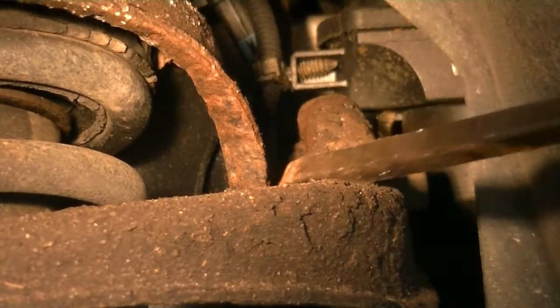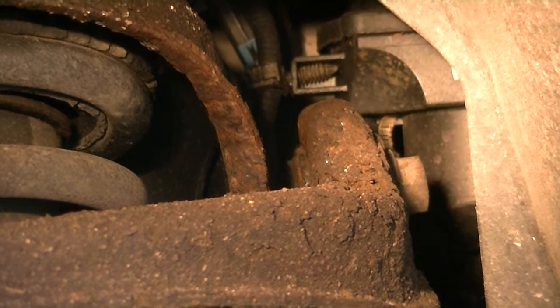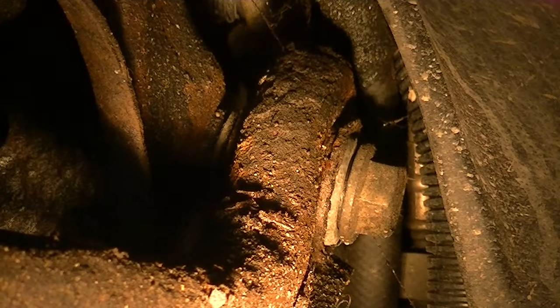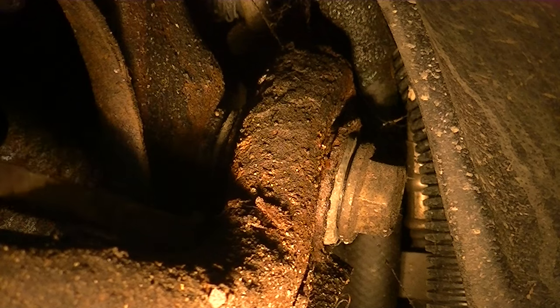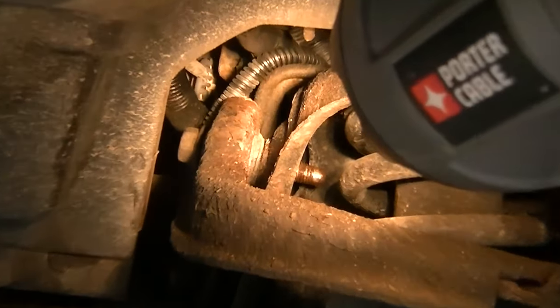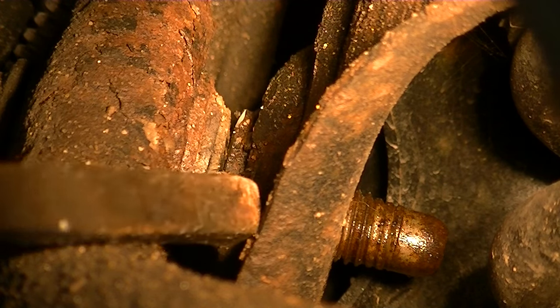So I've been driving this thing the whole time thinking it was just my imagination, and that's the way this thing was going to run. The lesson here is, if something doesn't feel right, trust your instincts — there's probably something bad. Now, for the fun of it, this is the driver's side. Better come over and check this side, because if that side's bad, there's a good chance the opposite side is bad too. Check this out — it's bad, too. See that? Let's check the front one on the driver's side here. Let's put our pry bar in there and see how much play we got.